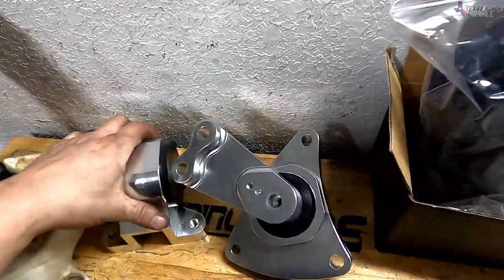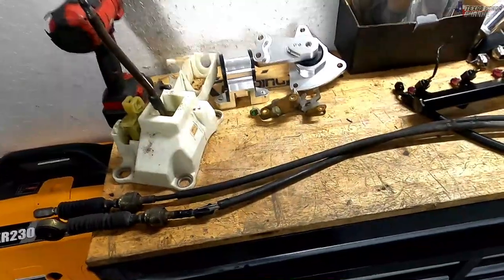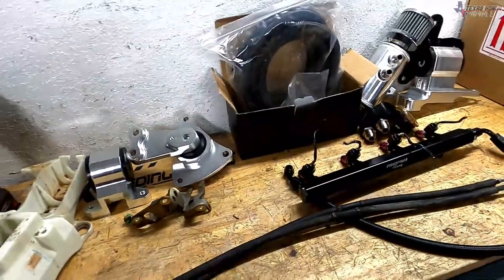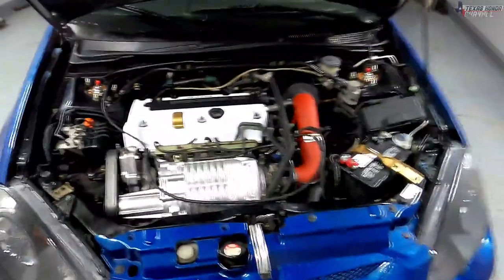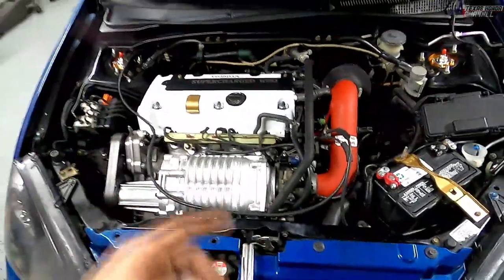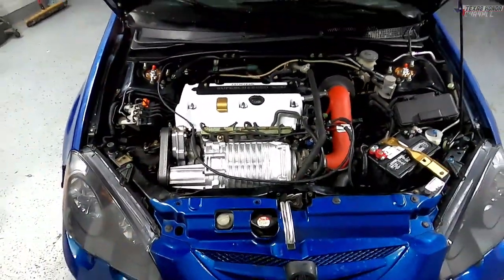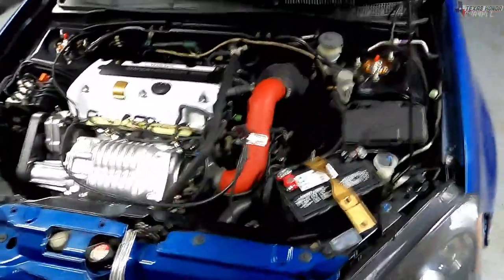I was going to try to get the solid mounts in during this video, but unfortunately didn't have enough time — I still have to edit this. It took a lot longer to record than expected, but either way it's done. So now we can move on to the next thing in the next video, whether it's solid mounts, the catch can breather, or maybe the injectors. We still have to get this thing dyno tuned — I need a little more funds, trying to sell some more merch. We need to get this on the dyno after I get the injectors in it. We'll still have to upgrade the fuel system to do a return line in the future. We're going to see what we can get with the 1000 CC injectors tuned on 93 — not doing E85, we'll go over that in another video. Really happy with how it's turning out.